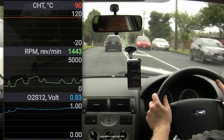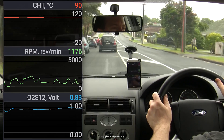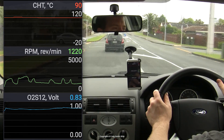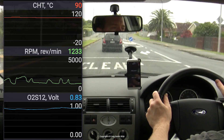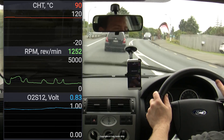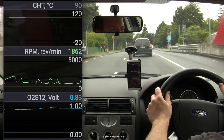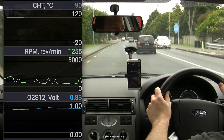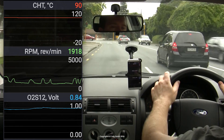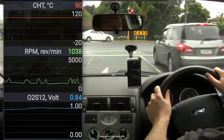This is a pretty good average that you can see. It might be less obvious in your case — maybe switching a little bit — but in aggregate, the voltage should be above the halfway level mostly. And while O2 sensors get lazy as they age, it's not as important in the downstream sensor, because even when in prime condition, the downstream O2 sensor is just not expected to switch quickly. So it just doesn't matter as much as with the upstream ones.